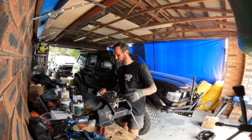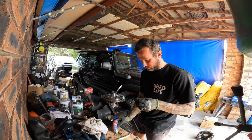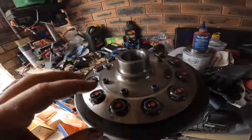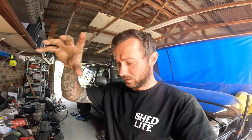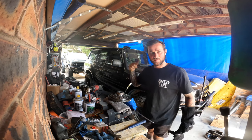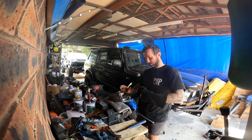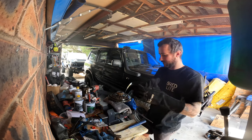I'm going to undo them one by one and thread lock them, which I should have done to begin with. Just want a dab because it will spread. I've now got all of them thread locked — put a dot on every single one. I've only just taken them tight with the drill; I've still got to go around and torque them all up with a proper torque wrench. I ordered my locker off Superior, and Superior send you the fitting instructions which has the torque setting — 120 Newton metres. I've got two paint textas: red was for thread lock, and I'm going to put a white dot on all the ones that have been torqued up.